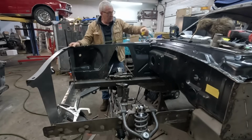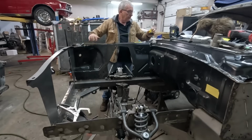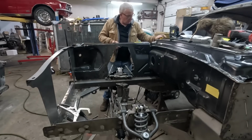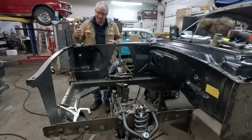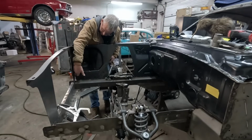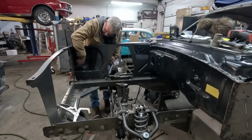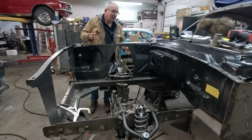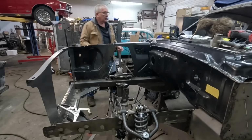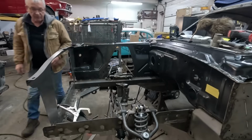What we've got to do is find some extra length here before we start burning stuff in, because we're like 1/2 inch light. So, a matter of finding where it is. That's where it is. Okay. It's going to be hard to see down here, like this is touching the core support panel here. All up here it's touching. We've got a gap here, coincidentally about a 1/2 inch gap. So we're going to need to release this clamp, slide it on forward, and get another vice grip on there.